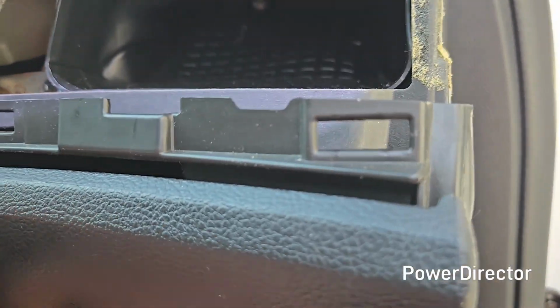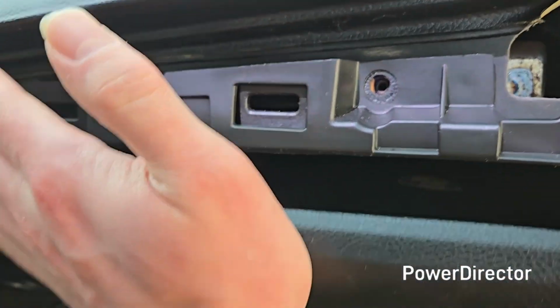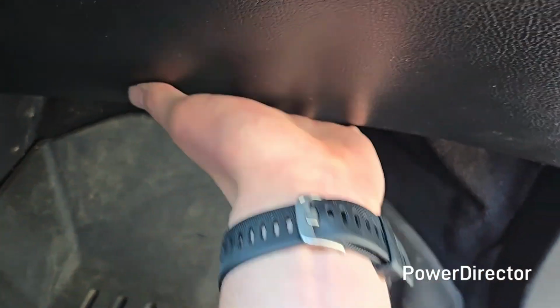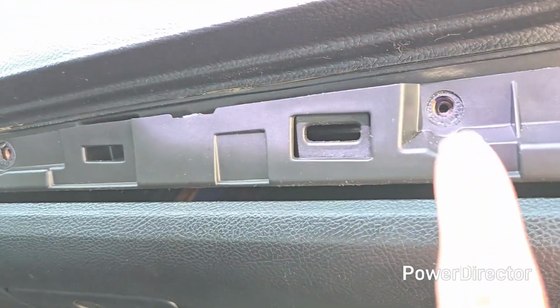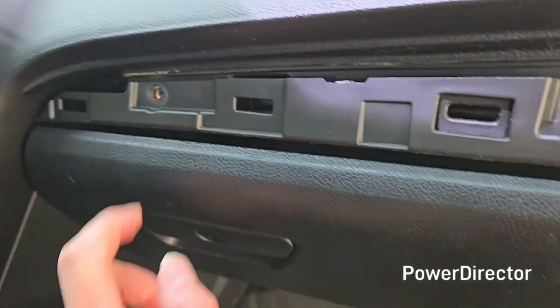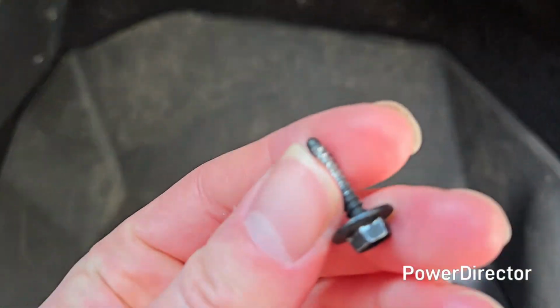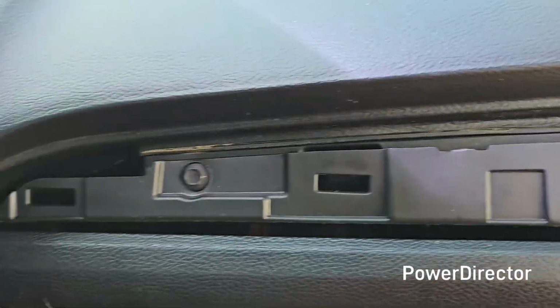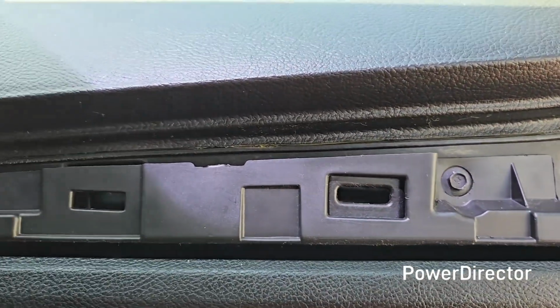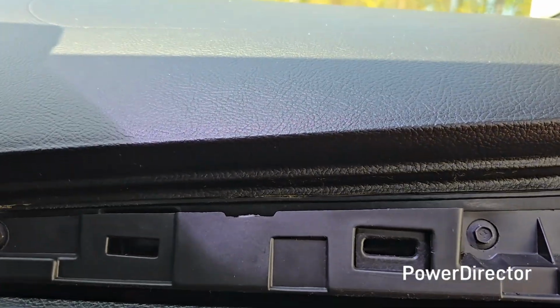Alright, so I got started and basically just push in, and then everything should lock into place. And just test it all around. And then after that, remember, don't forget your 7mm bolts. Just line those two up on top and then the other two on the bottom. Alright, so on all the bolts, just go snug with them. There's really no need to overtighten them.